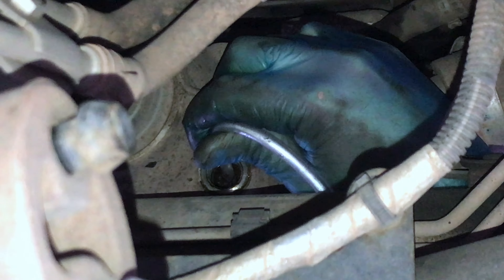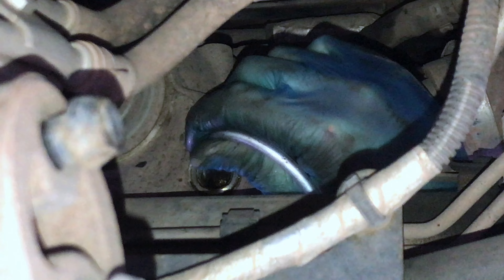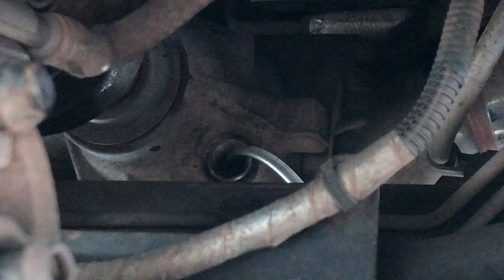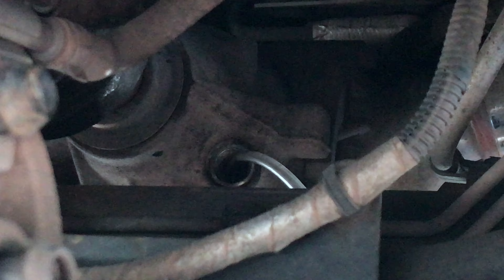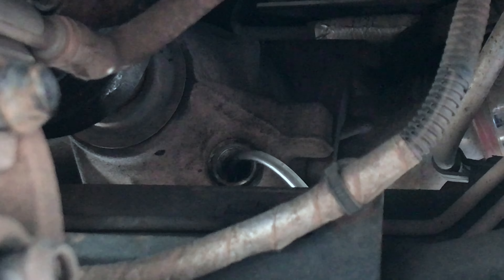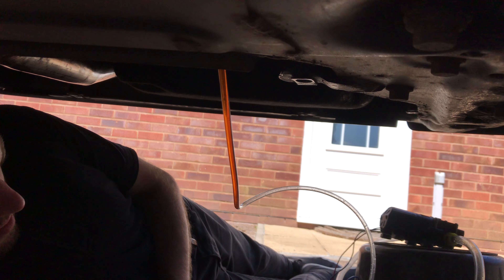Ben's put a small rubber piece of tubing inside the PTU — try and get it in as far as you can, work it in, to hopefully get out as much oil as possible. You have to persevere quite a bit pushing the tube in — there's a certain angle you've got to get it at, which is quite tricky. But with some perseverance you can get it in. With our battery connected, hopefully we'll start to see what comes out — with the pump going, there it is, it's coming through, very slowly.